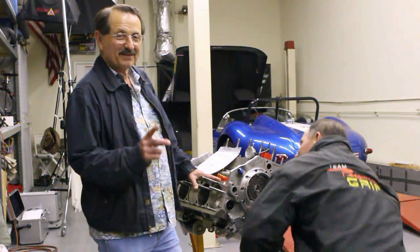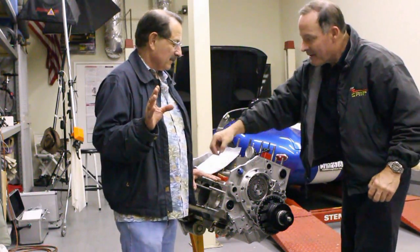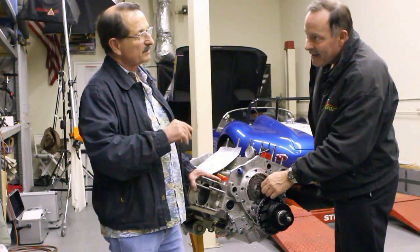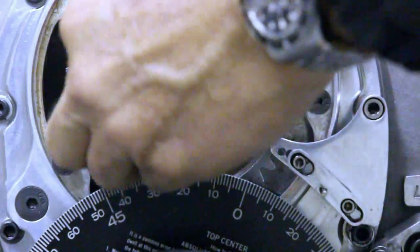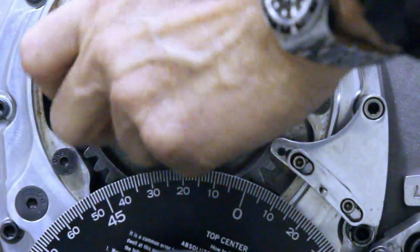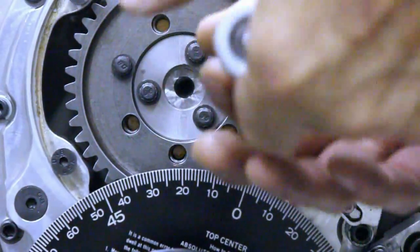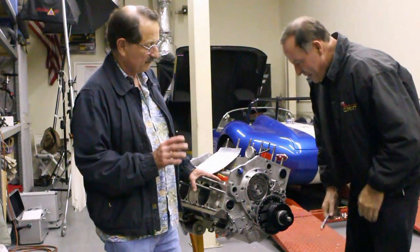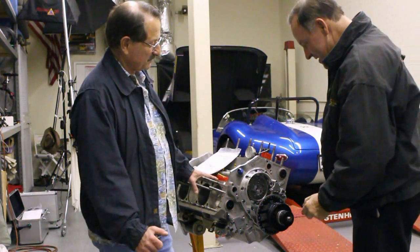Now, take a look — they are perfect. That's something to be very conscious of: you don't settle. You keep checking until, by eye, it looks perfect. If it looks pretty good but is off just a little, that's still not the right position. Try them all, and if you're not certain go back and check again — four or five times, or have a buddy oversee and back up your result. Unfortunately this is what you have to do because there are no timing marks; it's going in blind.